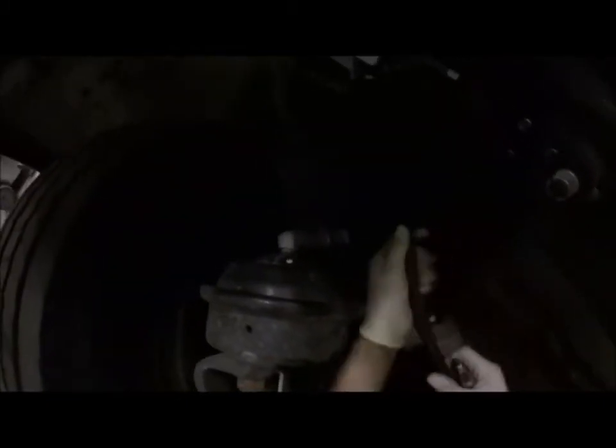We're put onto here because we had to tie this thing up. Careful not to cut my actual air brake line. That would be a bad day. Okay, now, typically I would run this over the top of here and into here. Now, I obviously left enough air line to do that. What I'm probably going to do is just run this behind here. Well, we run this over here into, just whip it up, run it like that into here. Yeah, I'll go with that and then we'll be fine.